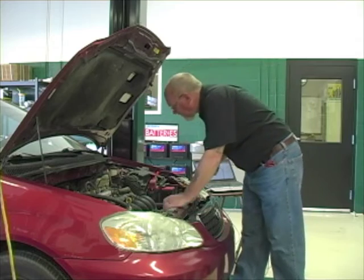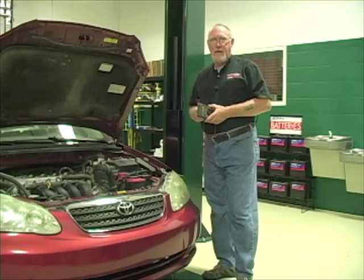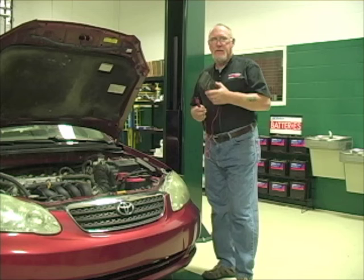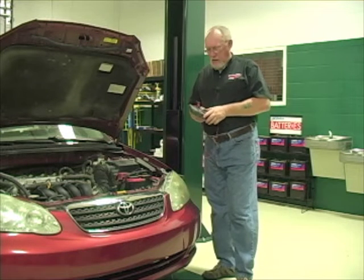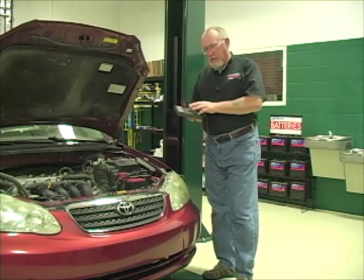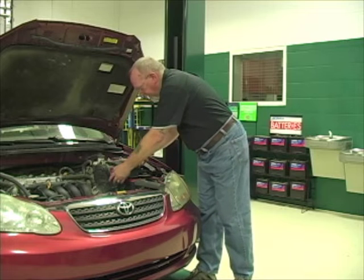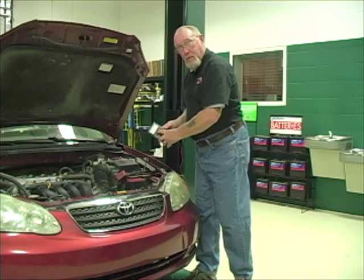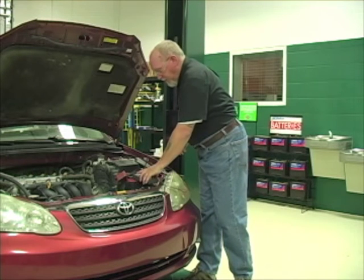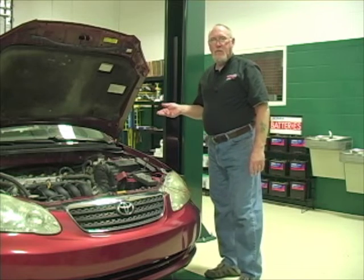Let's try a simple example — a simple battery charging system test. We've demonstrated how to test the battery starting charging system using the multimeter in another video, so I won't go into too much detail in this one. I'm going to set it on the voltage scale, connect it to the battery — positive to positive, negative to negative. I'm going to set the record button, then start the car a couple of times and finally let it run for a minute or two before shutting it off.